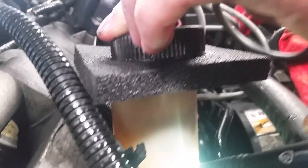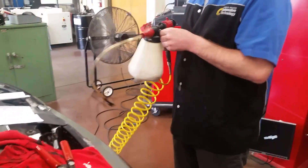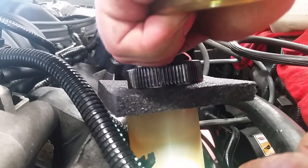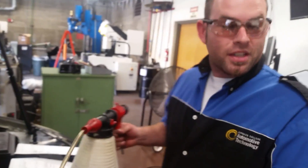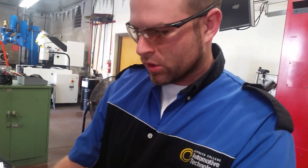We're doing that with it running. We've got our vacuum brake bleeder and we did that for a few minutes with the engine running. Now we've got a nice, quiet power steering pump — no more comebacks. This was its third pump, so that's it. I don't know what other cars it works on, but at least some Fords.